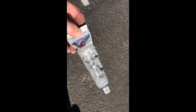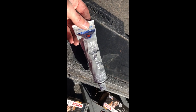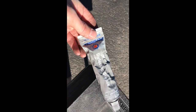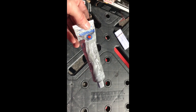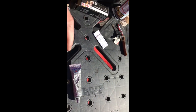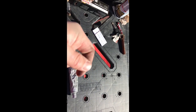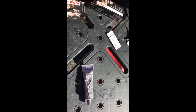I'm gonna put a little dab of dielectric grease on this little connector here as well - just to help protect it against the elements. The little plastic plug where it plugs into the wiring harness was a little busted up. The clip still works, but hopefully not letting some water ingress. We'll put this on there to help insulate it. I did notice on the old oxygen sensor when I pulled it out, in the wiring harness there's a plastic sheath that goes around it, and when I unplugged it and let it down, there was some water in there. Those wires are sealed and insulated so the water shouldn't be causing any shorts, but I'm gonna zip tie it up so it hopefully can't get any more water in it.